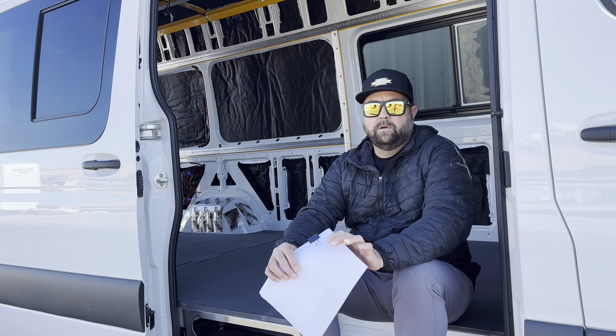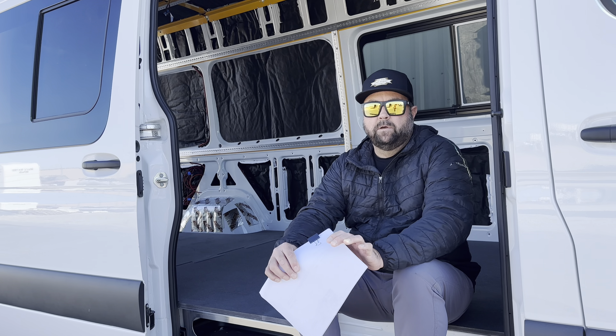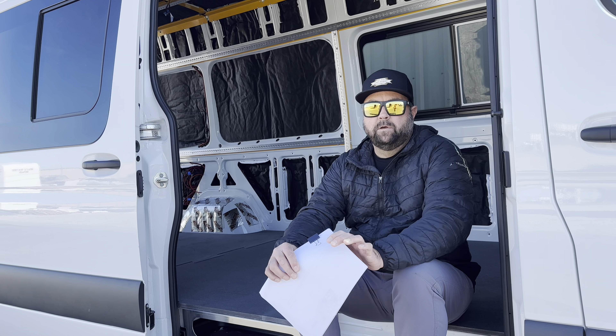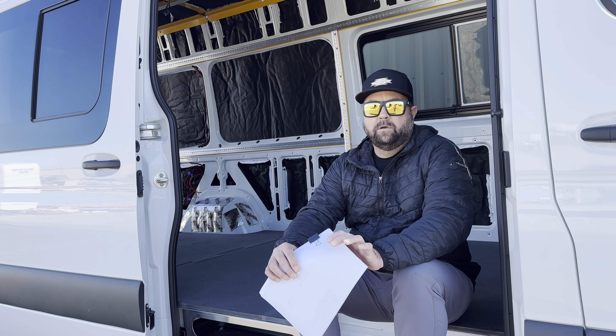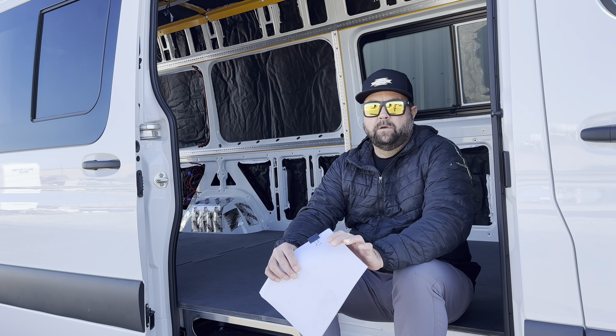DR-L3 is 48.5 inches. At the front seam, it's got a half hole, then the bolt is in the second full hole with a half hole. That's the front of DR-L3. At the back of DR-L3, you have three full holes — it mounts in the third full hole at the rear. That covers the driver's side.